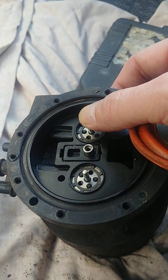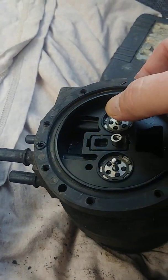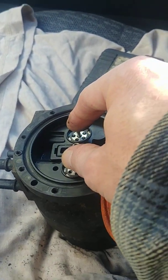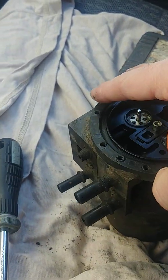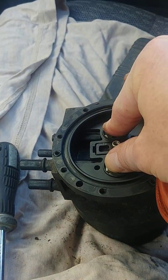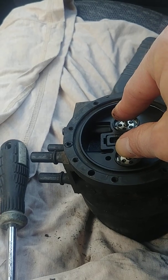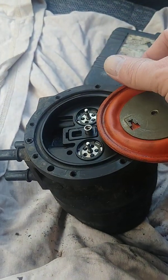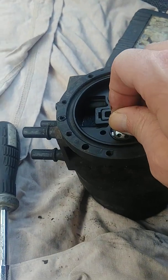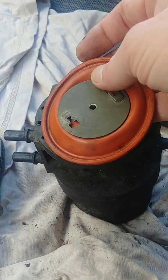When fuel comes from the top of this diaphragm, the pressure of the fuel pushes these pistons down — that's what selects your tank. So you push the selector button on your dashboard, fuel comes through these lines. The front or the rear go on top of the diaphragm and cause down pressure, or the bottom of the diaphragm causes up pressure, so it works these pistons. These pistons pull up — you can kind of see that. So that's how this thing works.